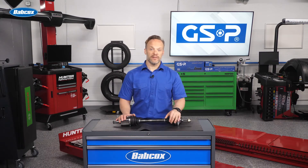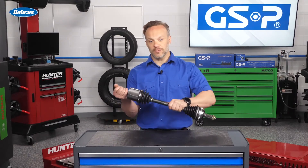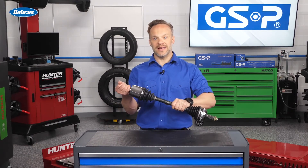Something else to take note of: if you have an end of the axle free, check to make sure that the slip joint moves freely without binding. If there's any binding or resistance, it's time to replace the CV axle. Diagnosing CV axle issues doesn't need to be complex if you know the right things to look for. I'm Josh Troche and thanks for watching.